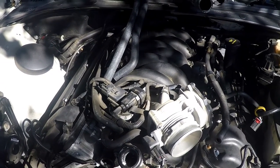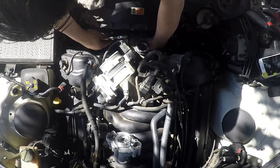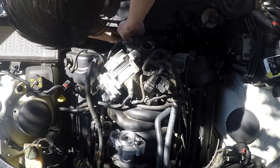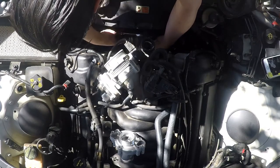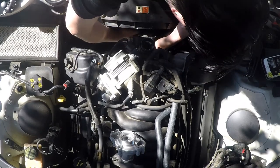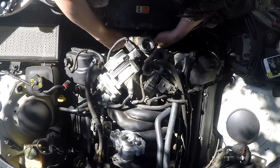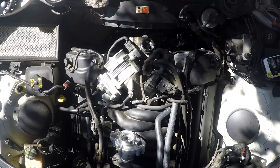Let me disconnect the mic, set it back up, and I'll try to do the time lapse before the batteries hold out. There have been a lot of bolts that are eight millimeters — it looks like all the bolts on the water pump are eight millimeter too. I'm using three-eighths drive just because I don't have a short extension for quarter-inch drive. They shouldn't put up too much of a fight. It's 18 years old but it has only 59,000 miles, so it doesn't have the mileage of grime and beating its whole life. I've also been trying desperately to avoid taking off the electric fan because there are a couple bolts I'm not sure I can get to.